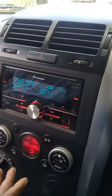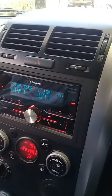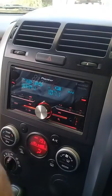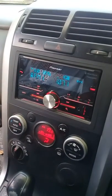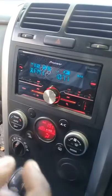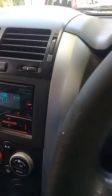What I've done — I'm going to proceed to check to see if the air conditioning compressor is coming on, and the fans that cool the radiator and the condenser, if they are working. If they are working, that tells me that the air conditioning system is working. The only problem I am having is with the blower. So we're going to proceed to check the air conditioning compressor and check the fans.